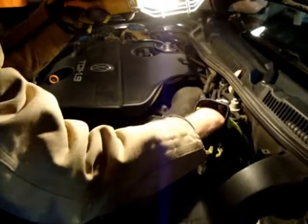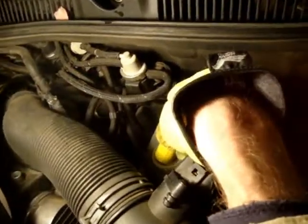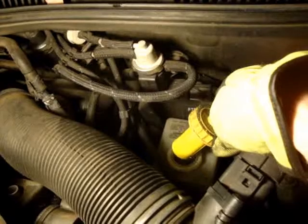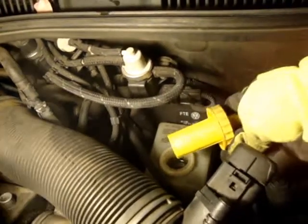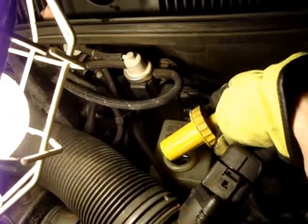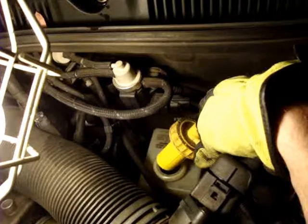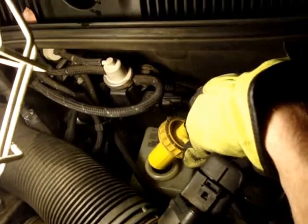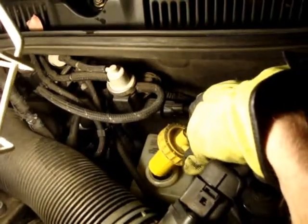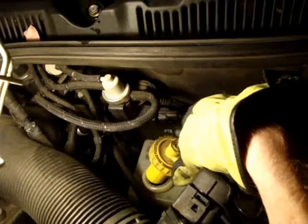We're going to come up here and take the top off of the brake fluid reservoir. The reason we do that is because as you're pushing those pistons back in, the brake fluid that's down in the calipers is going to be pushed back into this reservoir. It's important that the fluid not be topped off up here because we're going to be pushing more fluid back in. If you think it's going to overflow, I recommend getting some apparatus to suction some brake fluid out, because brake fluid will eat at paint.